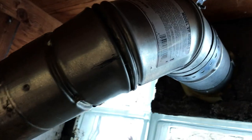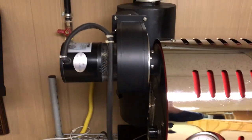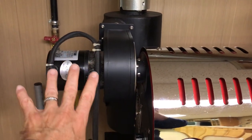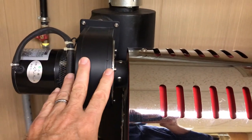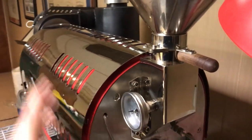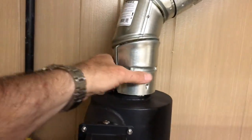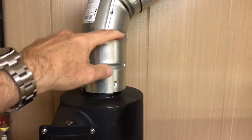This has really worked out great for me and I haven't had any issues with it. It's about time for me to take it apart to clean — I've had my roaster for a year. I have taken apart this fan system, removed it from the roaster, to clean out the pipe and clean out the fan, because airflow does get influenced. This is basic roaster maintenance. The other thing is adjusting the drum — how close it gets to this front wall — but that's for another post.